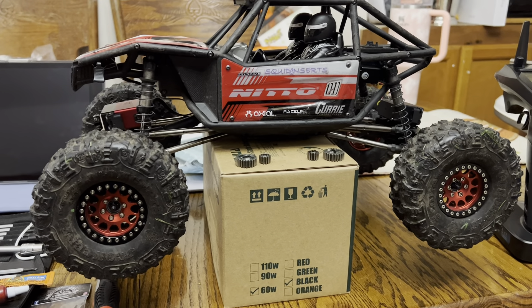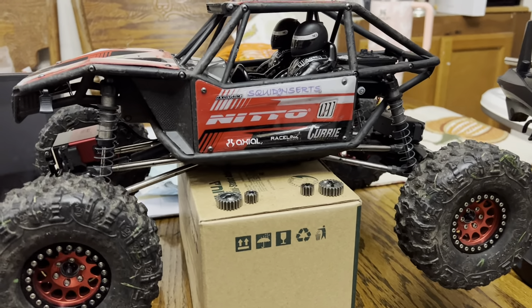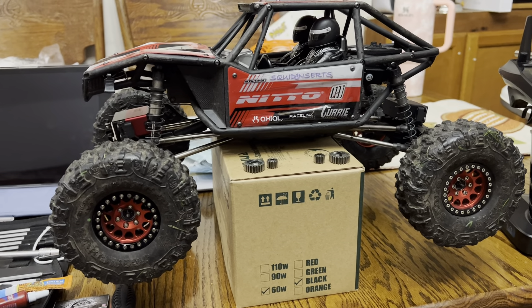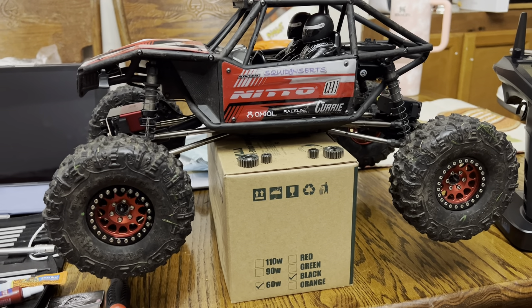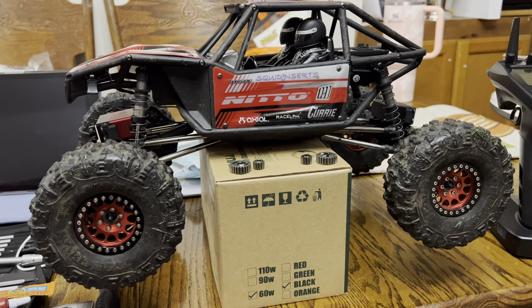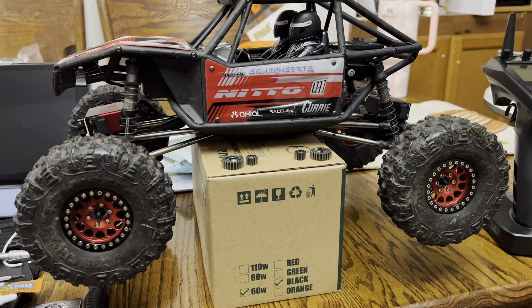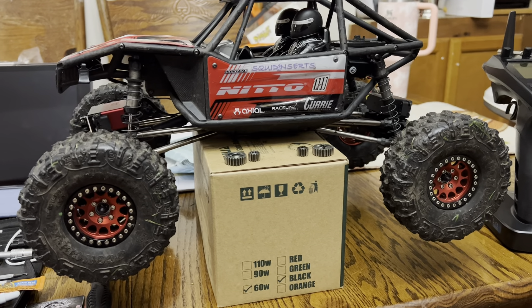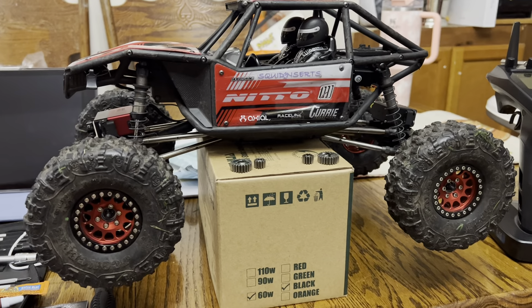Thank you Key City Hobby for helping me upgrade my Capra. Team Garage Hack makes three different levels — mild, moderate, and then Wild — and they recommended Wild for the Capra. It's basically 30% overdrive. They said 33% but it equates to about 30% after all the math. It's the most overdrive they offer for just a portal swap.